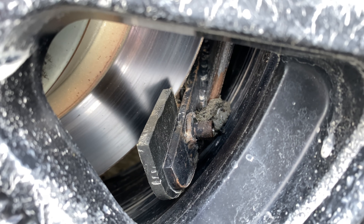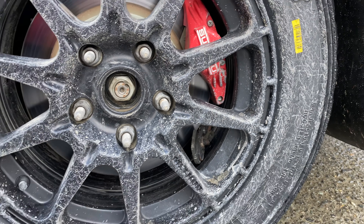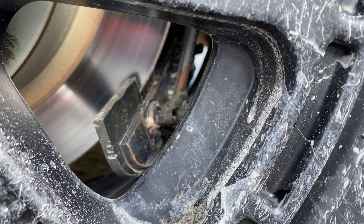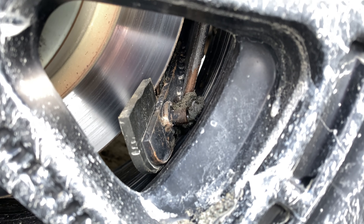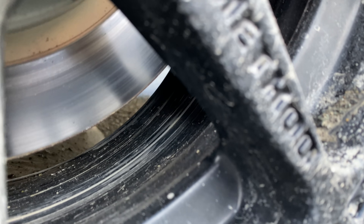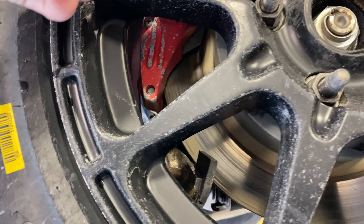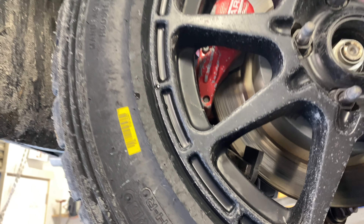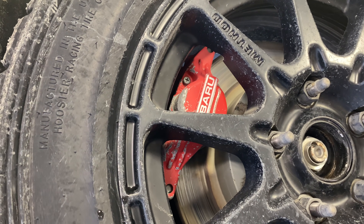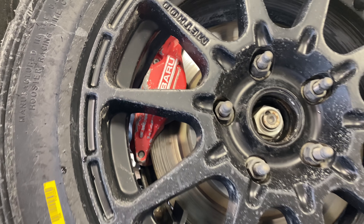For the rear brakes, there's another important element added: a wheel scraper located beneath the caliper. It's made up of a metal insert for mounting with an attached rubber scraper — basically like a windshield wiper for your wheels — rubbing the wheel at an angle and forcing out dirt and debris. Without this, dirt enters the rear wheels and essentially sandblasts the rear calipers, grinding down the outside of the caliper until the brake fluid inside is exposed, at which point your brakes fail. Dirtfish says without these scrapers, the calipers might only last about a month.